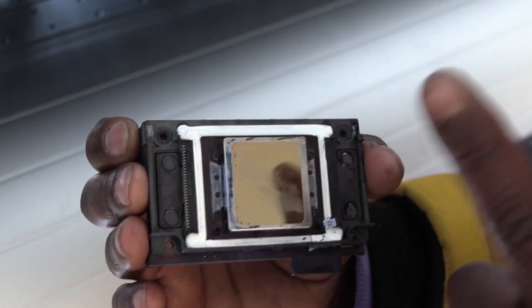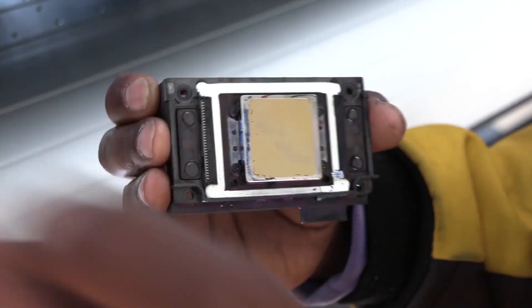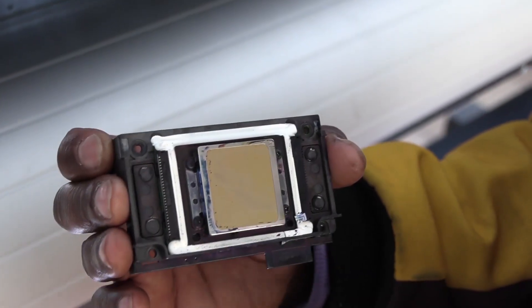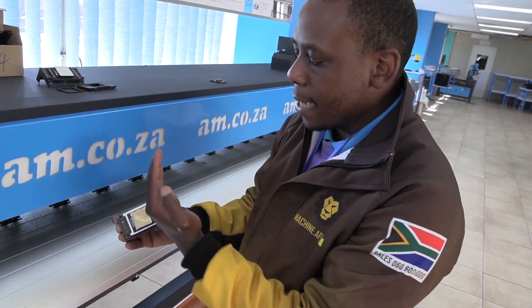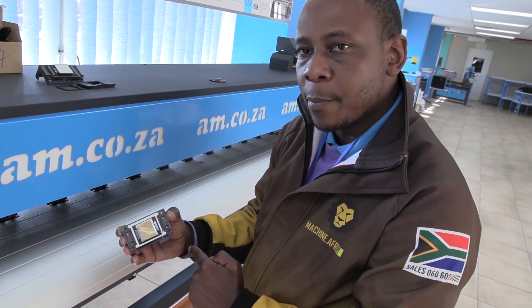Either one, when working on dampers with a syringe bleeding out your inks and you accidentally spill ink, it flows with the belt into the electricals. And two, when the machine is running a cycle of cleans as you print, the wiper has a tendency of leaving ink flowing way up above and then getting into the cables.